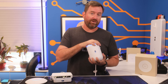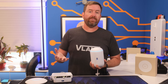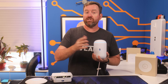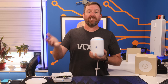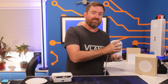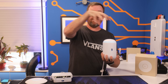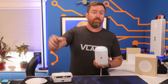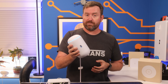The main downside to the Dream Router 7, in my opinion, is that it is an all-in-one unit. One of the benefits of stepping into the UniFi ecosystem is that you can really custom tailor your gateway, switches, and access points to your individual needs. For example, if your ISP hands off your internet connection to a front bedroom, with the Dream Router 7 installed, your access point is stuck in that same location. You have no ability to separate the access point from the gateway and put it somewhere that may better provide wireless coverage. So depending on the layout of your house, this might not be your best option.